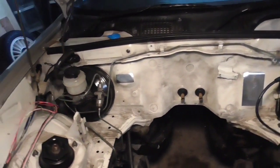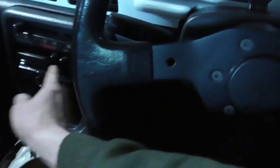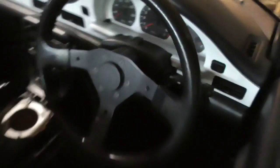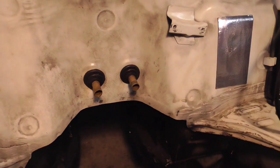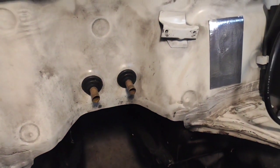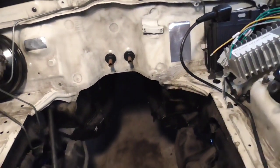So the flapper control on the inside there, just like any car that does not have an electronic control, has a mechanical one, which is what this is right here. There's a cable in there, and when you move that, that flapper opens and shuts the valve for the heat coming in, or from the hot coolant would be coming in. So that's looking really cool, really positive.